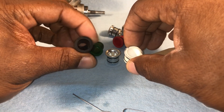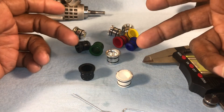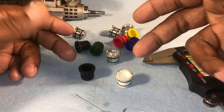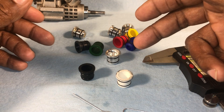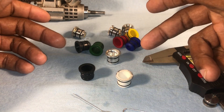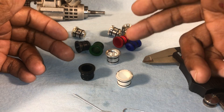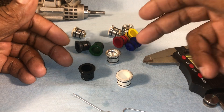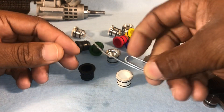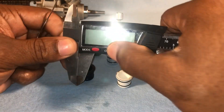When I tune my motors, the first thing I do is check the idle gap — it's very important. I set my idle gap between 0.7 millimeters and 1 millimeter. Some people do 0.5 millimeters and that's fine, but I try to stick between 0.7 and 1 millimeter. The way I do it is I take a regular paper clip — you can use any piece of wire — just make sure you measure it.